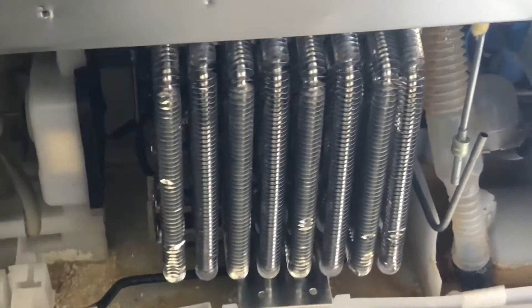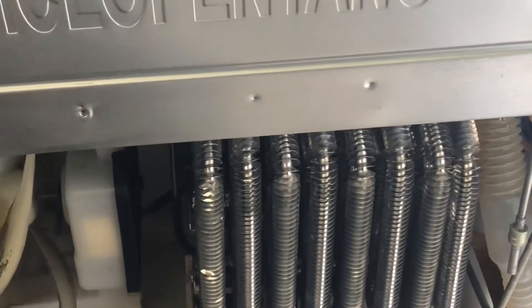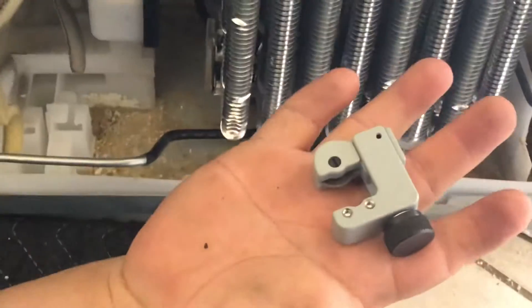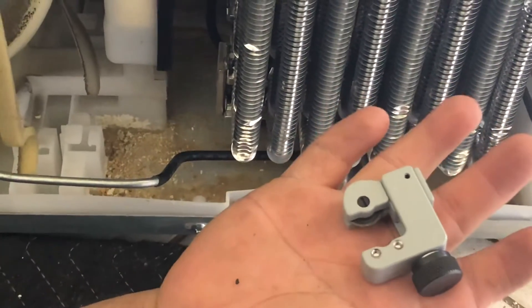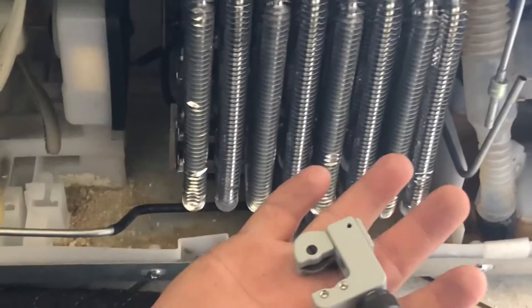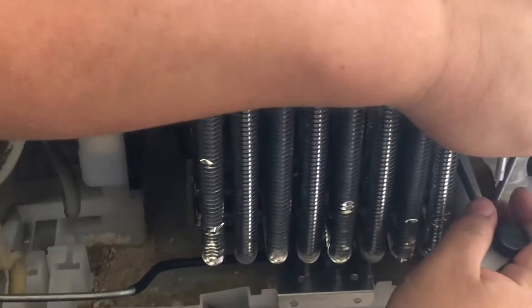We cut it below the joint right here, and the reason for that is we didn't want to cut too much. So right now we're going to cut it to size. I also want to recommend the tube cutter that we're using — we've got a little mini one by Yellow Jacket. I'll leave the part number in the description and a link to it down below. These little ones are very good because they can help you get into tight spaces.